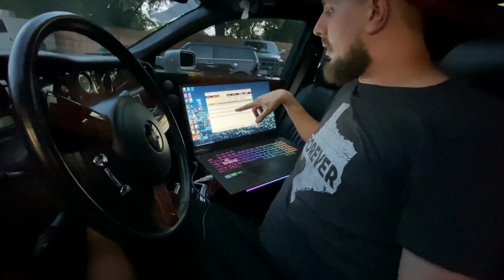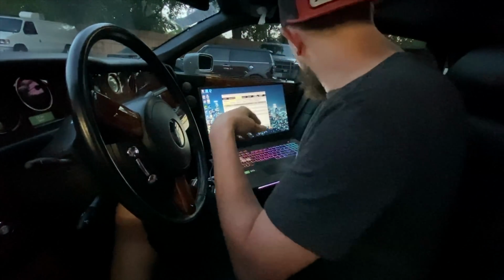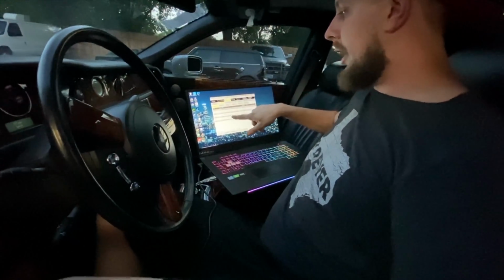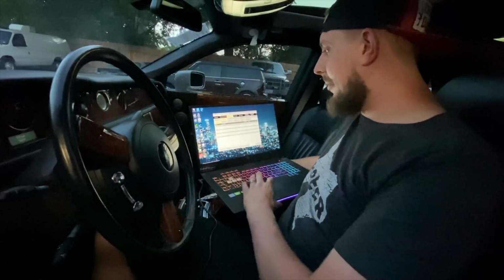These are our current faults. IHKA, these are not a big deal. These are vent flaps for the rear AC. It's just saying that they don't adjust at the speed that they should. IHKA is the climate control module. It's just saying that the vent flap in the middle, my indirect vent flap, is slow. Well, that happens with age. We'll see. But that happens.